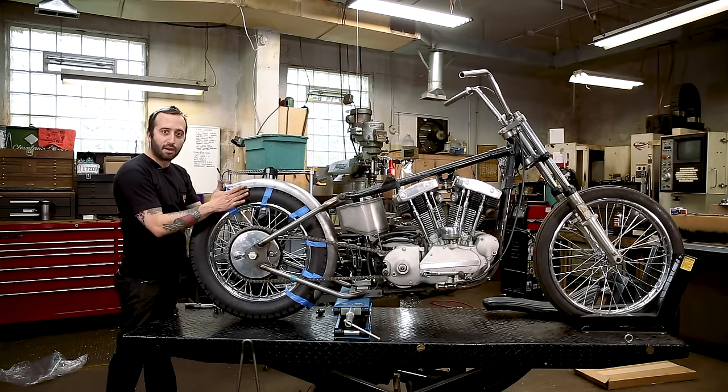And you could even tack these to the top if you wanted, so then you have a little space to clean off just around the top of the washer. If you tack these in a couple spots, you could clean the paint off of that area, and then this should bolt really flat, super happy, no smush of powder coat or paint or chipping paint. There's a lot of different ways to do things like that to keep your bike looking really nice for a really long time.